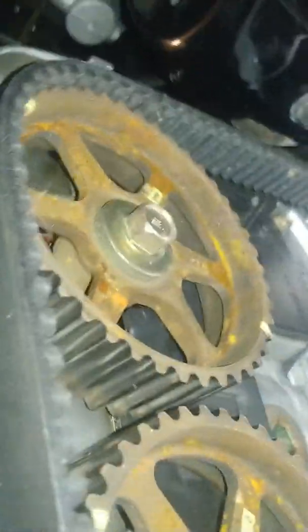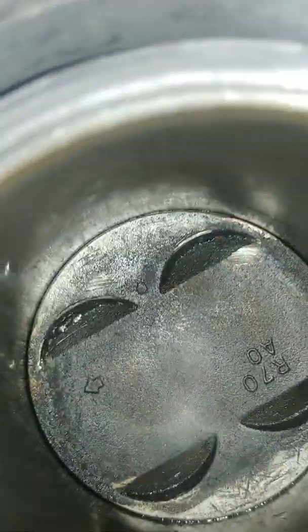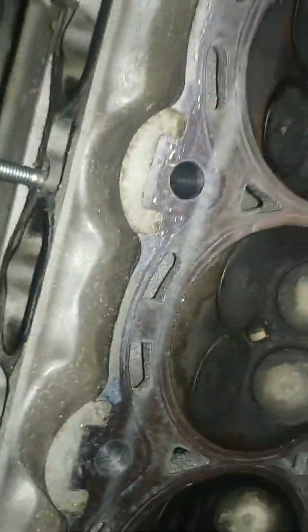You can see how much the belt was trying to walk off. I cut the top open — just like my hatch I can show you guys. We'll walk over there. This is the J35 that blew up — you can see the piston sideways in there, threw a rod. I got a video of this. Chad and I started taking it apart just to see what was hurt, and you can actually tell there was some piston-to-valve contact top right, top left. So anyways, we definitely got bent valves. It was leaned out too. But anyways, we're going to show you the hatch — I have the same setup on it.